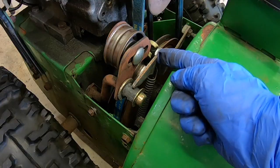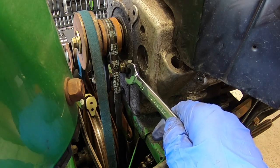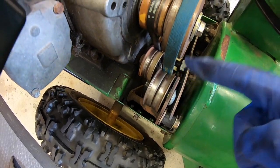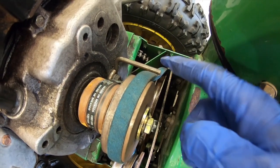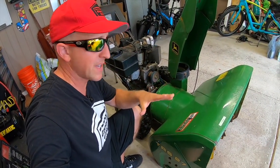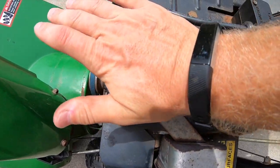Make sure your pulley still spins freely. For the next part I made sure my pulley brake is back where it belongs right in this channel. Remember that bracket that broke off - I'm actually gonna take this old one out because this one is snapped off. Be sure to reinstall your belt guides and if you have multiple belt guides make sure you reinstall both of them. Over here there's a pulley creating a lot of tension against the bigger pulley up top, but over here there's nothing - so to have a belt guide here I feel is more important, so I moved it there. This should help keep that belt from slipping off on this end. Now before reinstalling the cover and attaching the chute back together this would be an excellent time to test it out - reinstall the spark plug and start her up.